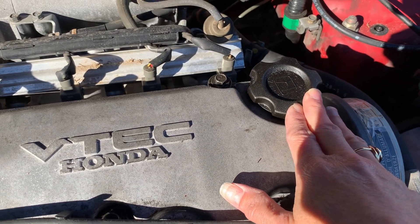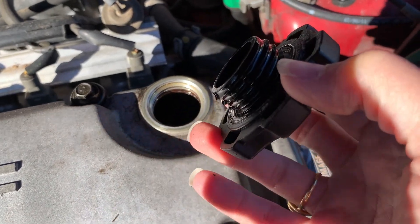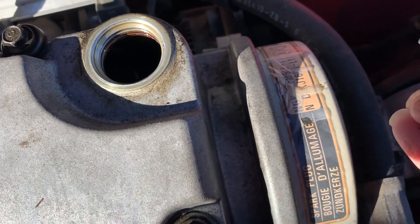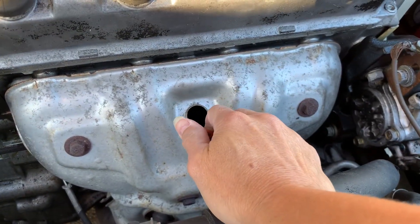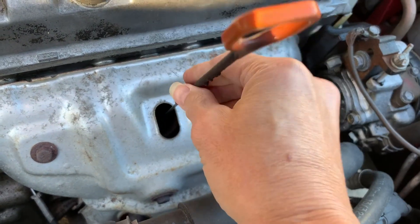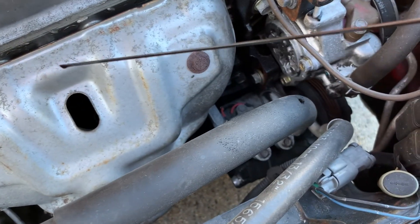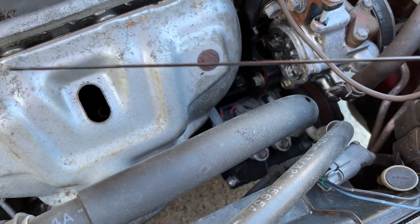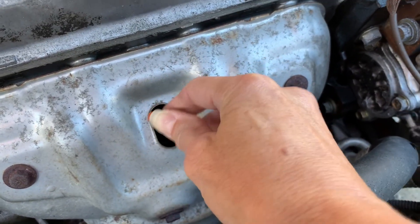This is where you add your oil. You should check with your book to find how much oil you need and the type you need — sometimes it's written on the cap. Down in there, that's the top of the engine with the rocker arms. And this is where you check your oil. You should not do this at night — it's really hard to see that hole, I learned the hard way. The oil should be above the top hole; if it's below it, you should add some. Make sure it's pushed all the way down so no oil leaks out when your engine's running and causes smoke.